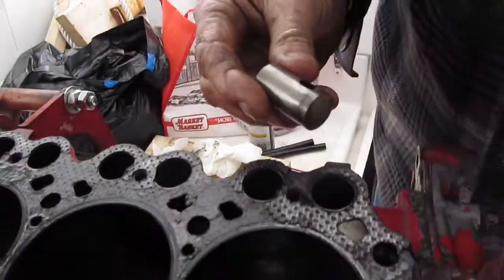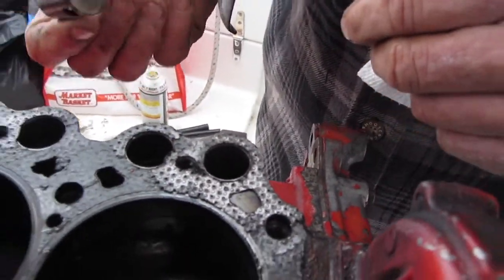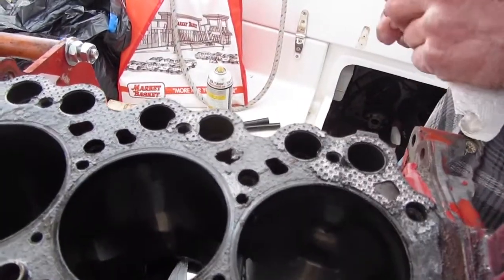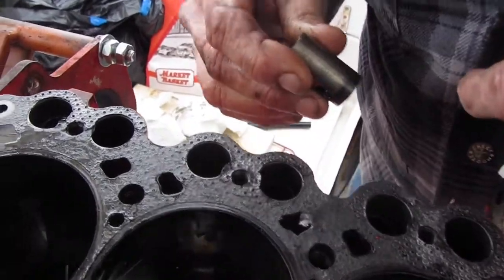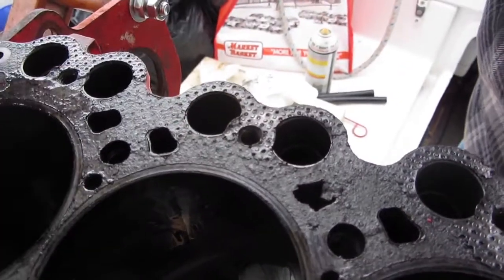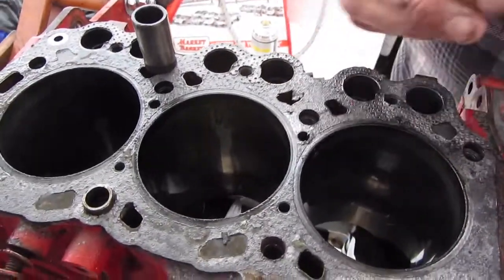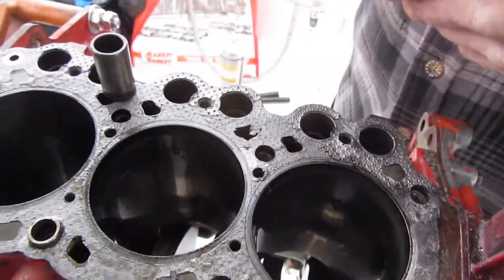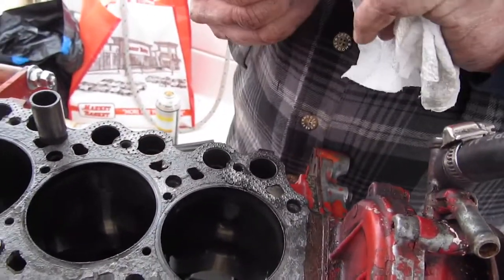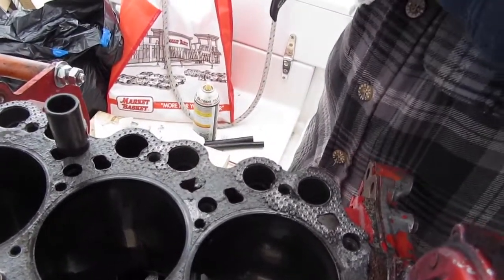The lifter sleeves have a hole, but it rotates — so it doesn't matter which way it goes. We've got to pull the rest of them out and clean it out, blow it all out. We're not sure which these came out of — there are two missing right now, and then we've got one, two, three, four. Fortunately for us, even though we didn't pull them out, there is no wear, so it'll still rotate no matter which way. We pull the push rods out — the push rod goes right through the center of the lifter, and this hole oils the push rod end.